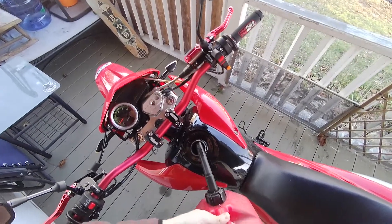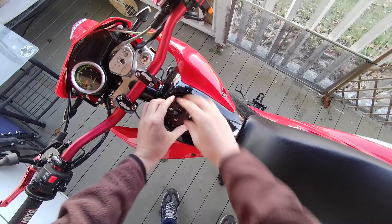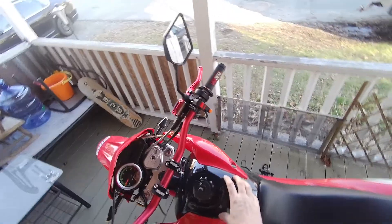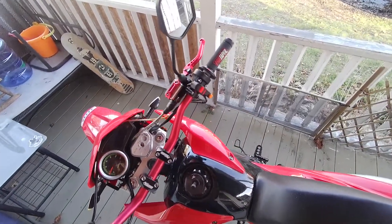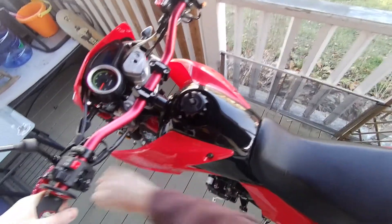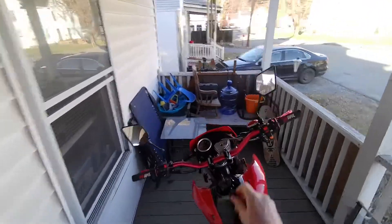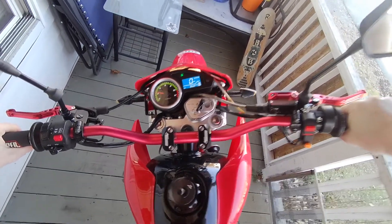Now I'm going to top her off. Some of you might say 'why are you doing that, drain your gas tank?' I would agree if it was a plastic tank, but it's a steel tank. I feel it's better to just fill it up so that it doesn't have room for moisture condensation — or at least as much. With a plastic tank I'd probably just drain it, but this was already about three quarters full. Now I'm gonna start it and let it run through the carb a little bit.